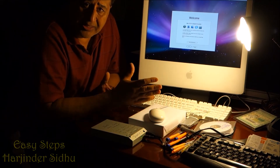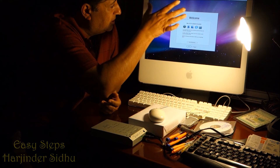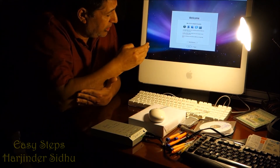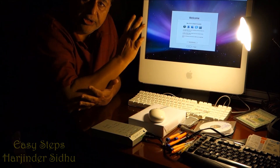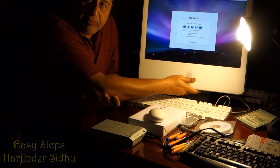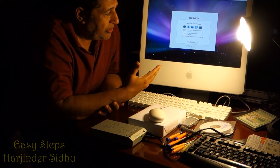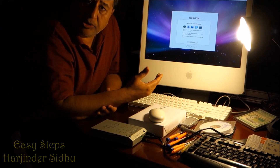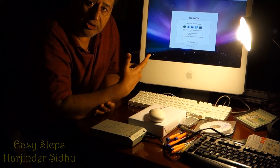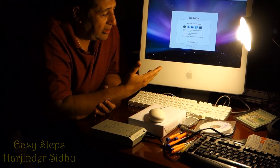Button everything up as mentioned: make sure the tape is sealed at the front, put the screws back, reconnect the LCD cable, two connectors on each end, then the four body screws, and the two memory panel screws. Everything is now in perfect order. Time to put the operating system back — go to Disk Utility, make the partition using GUID partition scheme, then install.